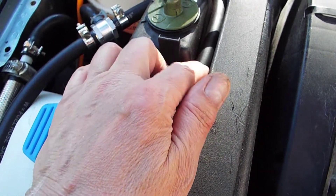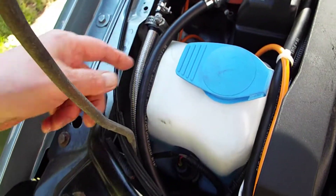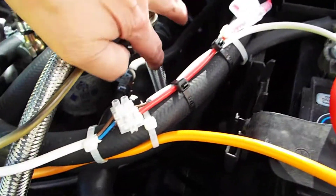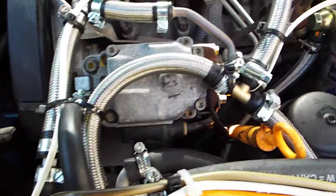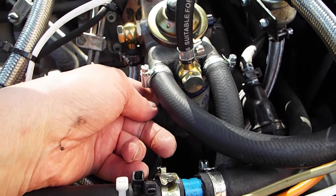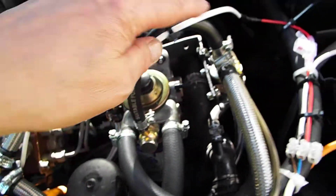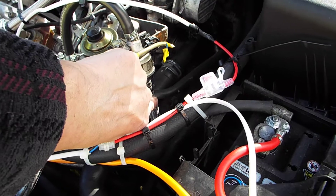That returns to the small tank for purging. So we've got our two feeds. The diesel feed goes to the fuel select valve here — that's the diesel input at the bottom. And the veg oil is fed into the Perflex filter, where it gets heated and filtered. Because it's warmer, it's easier to filter. The output comes here to the fuel select valve, so I've got fuel select: heated veg or diesel.